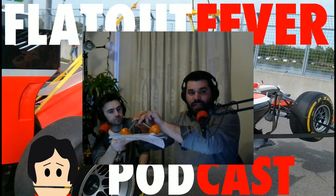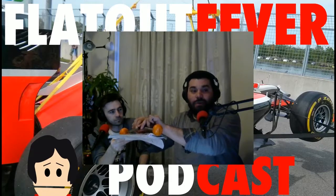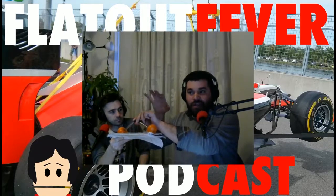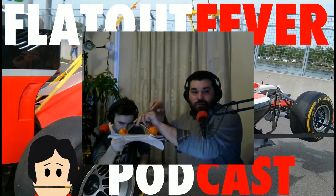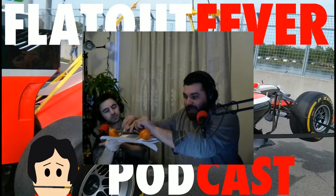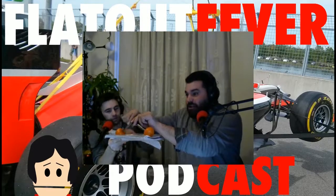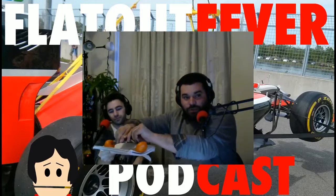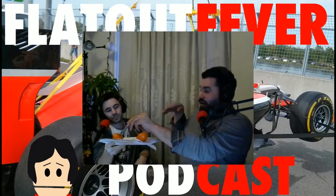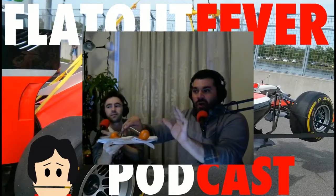Last year it was like this, and Kimi Räikkönen didn't like it. This year they're more like down here — stiffer suspension. Räikkönen likes it a lot. When the suspension was up high, every time you're braking the weight of the car comes to the front and it flattens the tires — you can feel it pushing the tires. There was a significant amount of force borne by the sidewalls just from going like that, like braking into a corner, and the camber of the wheels changes.